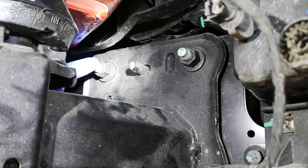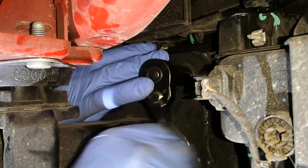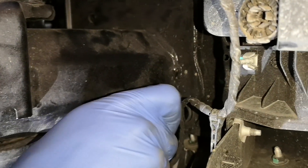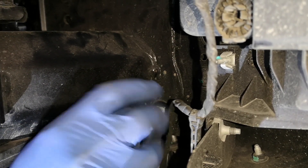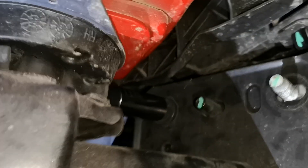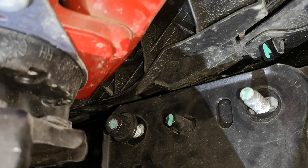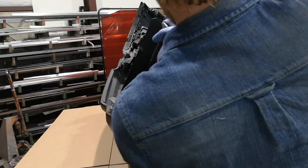Climbing underneath the truck, the front bumper is held on with six 18mm nuts. Looking at the passenger side frame, use a deep socket ratchet to crack those loose and remove two nuts on either side. On the third nut, thread it to the end of the threads so the bumper doesn't fall while you're underneath. With a friend supporting either side of the bumper, remove those two safety nuts and slide the front bumper off, placing it on a soft surface.